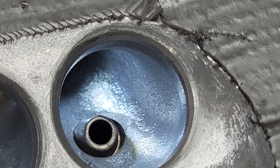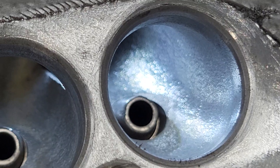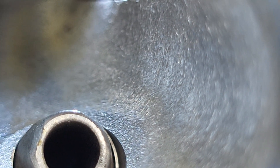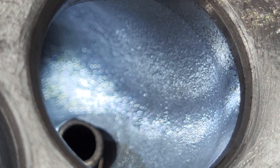This should work better at top RPM. According to the owner, he gave me some specs on the engine. The engine is 240cc's, 67 millimeter piston, crank length is 38.1, the throttle body is 40 millimeters. Two injectors. It's based on a Yamaha Zuma 125 engine crate — maybe it's a copy of the Yamaha, I don't know.